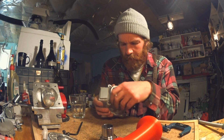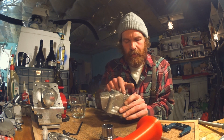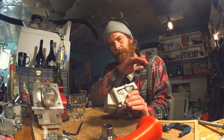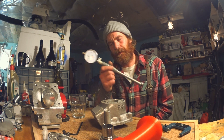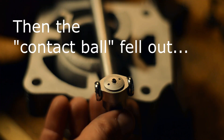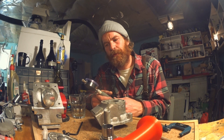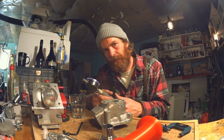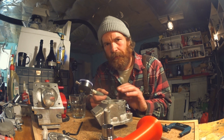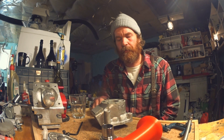Quick hone job — got rid of all those spots of nickel and boron nitride. I think the reason the acid didn't attack the nickel is because there was a high concentration of boron nitride in those spots, and it kind of masked the nickel. I measured it with this not-very-expensive tool, which has worked fine until now. I got a measurement of about 0.17 millimeters under piston size, meaning I can have a plating that's about 75 microns thick — that should be perfect. I'll plate it thicker, then hone it back to the right measurement.